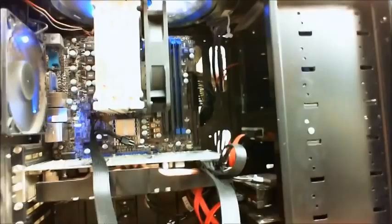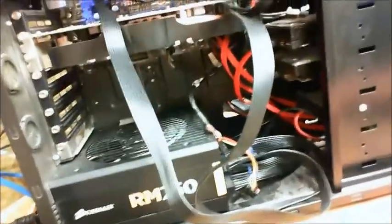This new one is fully modular, which is great — you only plug in the cables you're going to use. It has silent fan technology: the fan only kicks on when there's more than a 50% load on the power supply or if it's noticing extreme temperature buildup. Let me flip the camera around to show you. The inside of the case is a bit of a mess — dusty, wires need rerouting — but it's been running steady for just over a week. The webcam I picked up for about 40 bucks — normally about 70, so it was on sale. It's a Microsoft LifeCam, which is 720p.